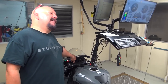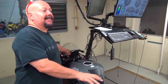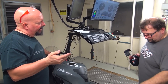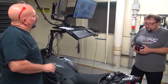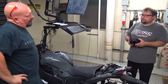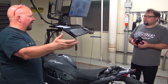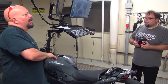Sure can. All right, Don, can we talk about exactly what was done previous to these changes? Were the only changes in the throttle blades, getting them to open completely, or did you have any other changes previous to what we just did? Yeah, we did some ignition. You can see where they pulled out a bunch of ignition timing up top. We did fix that at the same time, because you can't pull to the increased RPM range. How much RPM is this increased? It's 500 RPM. 500 over.